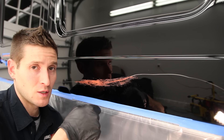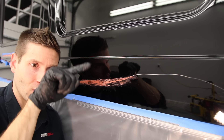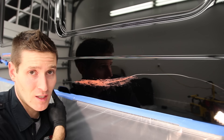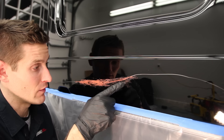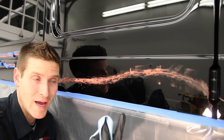Normally you'd just put touch-up paint, but as you fill it in and put the crown, it starts to sink and goes below — that's when you see the bump. If you go to sand it, there's still a hole there. That's why you always want to put a bit of a bubble, but that takes a lot of drying — back and forth, drying, put it on, drying, put it on. If it takes overnight just to let that dry, that's the catch: if you do it wrong, you've got to wait another night. So that's what can have you spending weeks doing this. Bondo shortens that by filling in that gap, and on top of it you put a nice layer of paint.